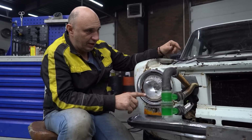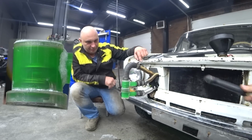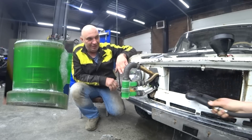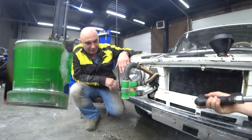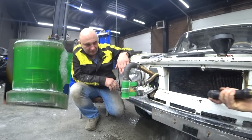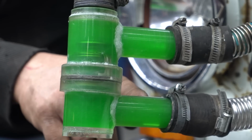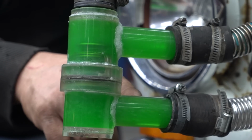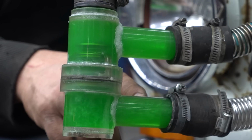Now we're gonna go ahead and cool the radiator off with a bit of water. The temperature should drop, closing the thermostat, reverting flow back to the small circle. Yeah, this is exactly what we expected would happen. We can now see the shimmer we used for coloration. The flow rate is dropping, which tells us that the thermostat valve is closing gradually. It's pretty much come to a dead stop.